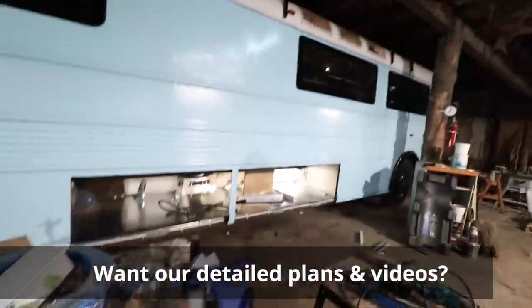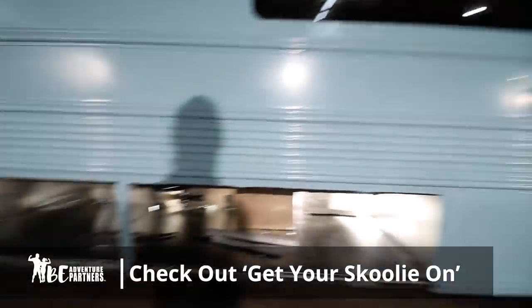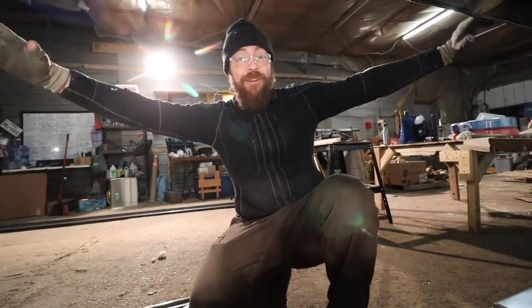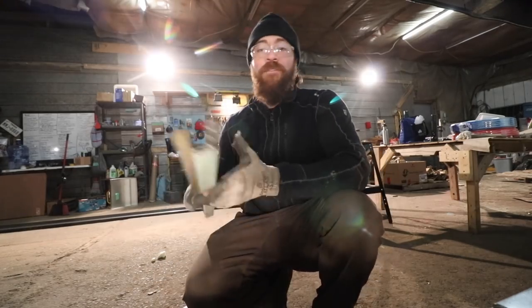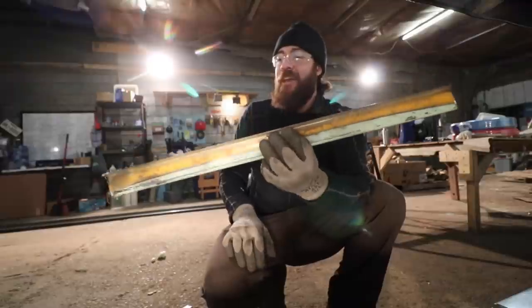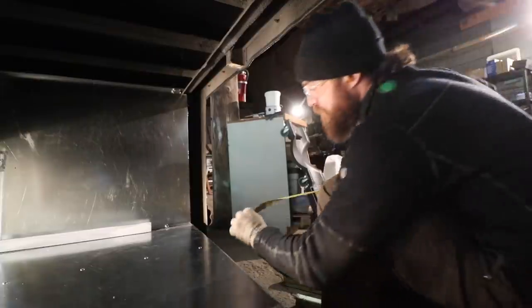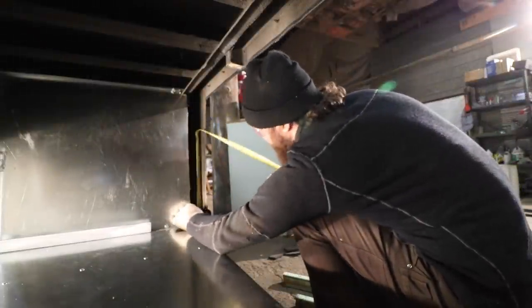I've drawn out some plans for these doors just to get some rough measurements. Something to note is we've got hat channel here and hat channel over there, but there's no hat channel here, so affixing a piece of angle iron or some sort of upright support will be kind of difficult. I grabbed some hat channel from the bus demolition when we took out the windows — those ribs came out with the hat channel and they're going to work perfectly. We're going to cut these to size and get them installed. First things first, I'm going to measure the area.